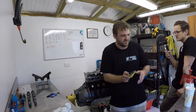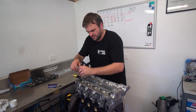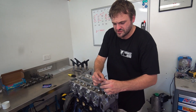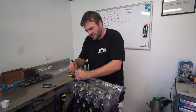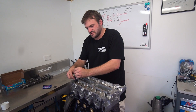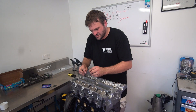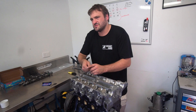I find it's just a safety thing, mainly because of the turbo stuff we do. If we have too much ignition timing and timing fluctuation at high boost, you can lift the cylinder head. The Hylamar is just a bit of a safety barrier — you'll have less chance of it not surviving. You can pressurize the coolant system and the Hylamar can bite back down after the head drops.